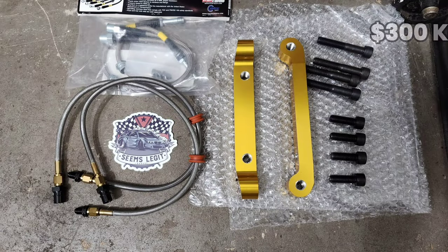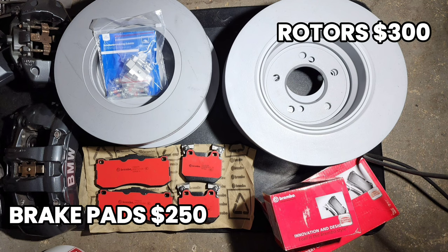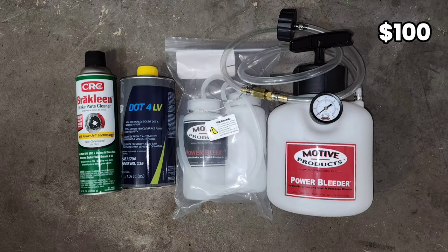Now I'm going to go over everything you need for this conversion project. Custom brackets from Seems Legit Garage, along with front and rear brake lines. You will need to order rear E46 M3 rotors. I went with ceramic brake pads from Brembo, and also brake cleaner, brake fluid, and a pressure bleeder to finish the job properly. All of these parts will be linked in the description box below.